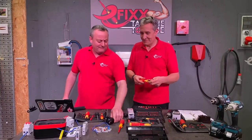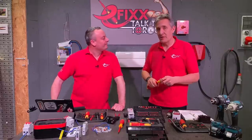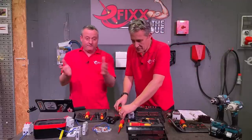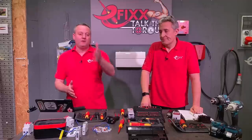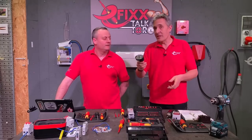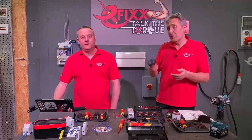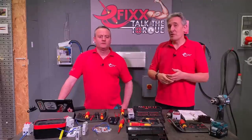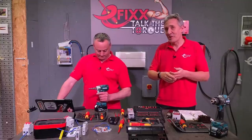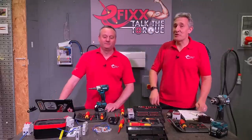The Quick Check is not a calibration tool itself — it works for a certain prescribed check. If you've got a team with lots of torque screwdrivers you can bring them in periodically for a quick check. For best practice, when your MFT comes in every three months for internal checks, check the torque screwdriver at the same time. It could also be an idea for wholesalers selling Wera equipment to keep one of these on the counter, so customers coming in can quickly check whether their screwdrivers are operating as required. We're always interested to hear your thoughts about torque — check out those other two videos: what happens when you use an impact driver on electrical equipment, and have electricians got calibrated arms.